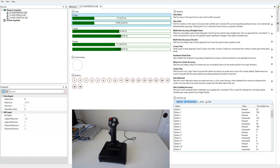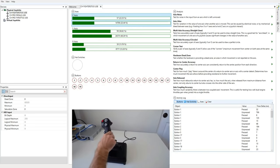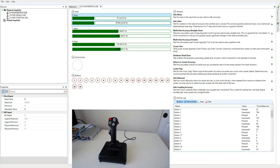It's just the lack of any mitigation for that clunkiness when it crosses center that just kills it for me. And then the imprecision of the electronics is unfortunate as well. 8-bit precision is low enough to have an effect, although it will be a subtle one. I prefer to see 12-bit or higher. And so sadly, I think the axes actually come out being a weak point on this joystick.